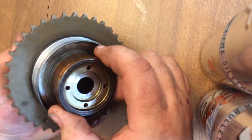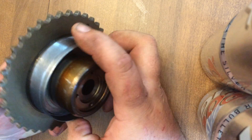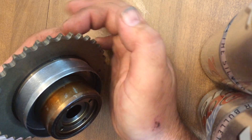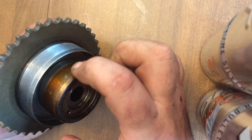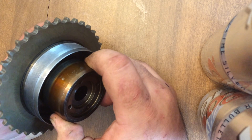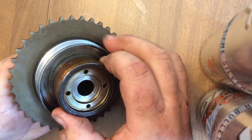As you can see, this is how the piston works inside there. If this thing's in the engine, this is the front of the engine, rotating in a clockwise direction. With the piston fully retracted in its retard position, all the oil is towards the front of the piston pushing it back. As oil is directed to the rear of the piston pushing it forward, you get 20 degrees of movement in the cam — 20 degrees advance, and then back to its full retard position. And that's all I got.